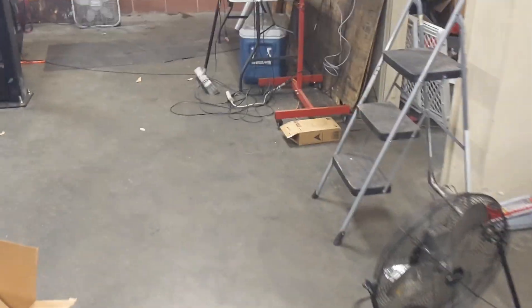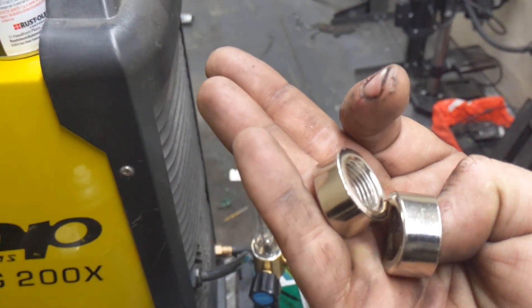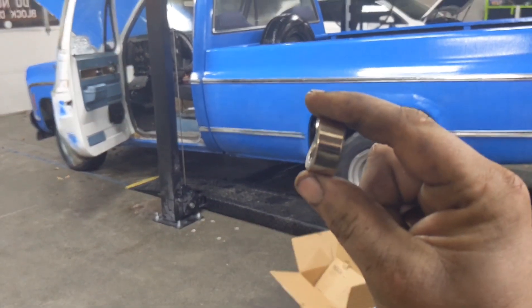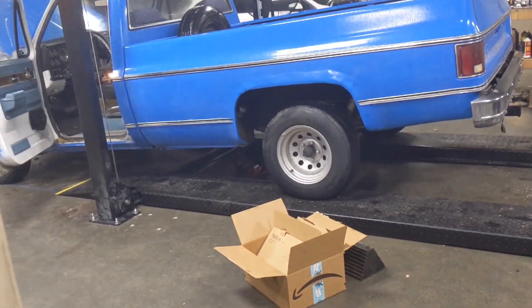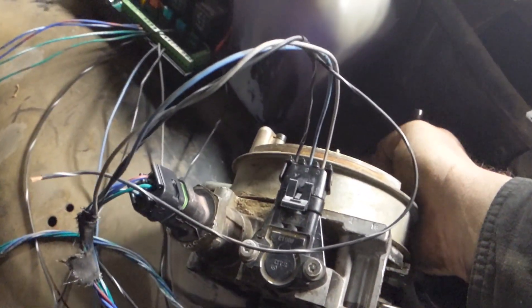Back on the outside of the truck, I come over here to my welder and I got these two sensor bungs so I can add dual widebands to the exhaust. I nicked my finger on something — anyway, I'll weld them on and show you guys pictures, probably some video too. So we're making progress. I picked a spot for the relay board, and I figured I would test the TPS and the idle control — those two right there — and they work, so that's awesome. Two sensors I don't have to replace.